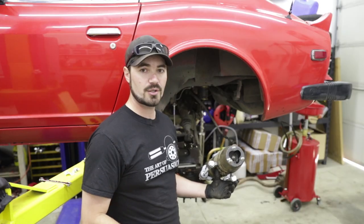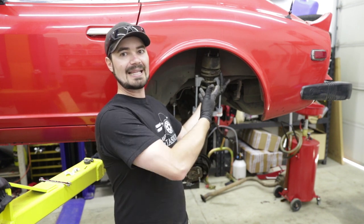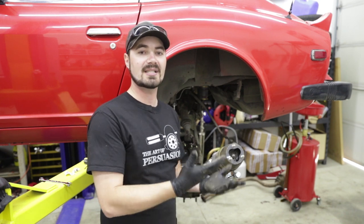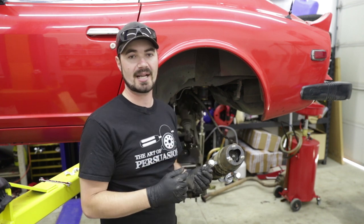Once you've done all the work, all you have to do is tip the assembly back up into the strut tower, lift it up, and either put a nut on top or attach the axle again to hold it in place. The axle will hold the assembly close enough that it's quite a short push to get it back into position.